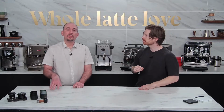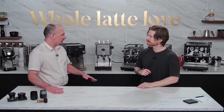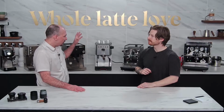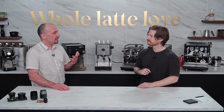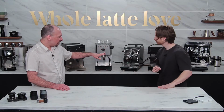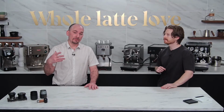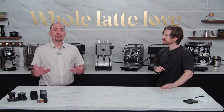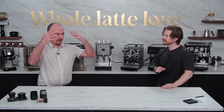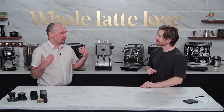Yeah. And so with the Latte, it is sort of addressing the potential issue that you may run into with any machine that is using some kind of pre-infusion that's taking water from the boiler without necessarily using a pump pressure, which is that in some cases, as we'll see on some E61 machines that we have here, you don't have much pressure left, so not a lot of water can actually flow. So it's actually pretty clever what they've done, where having the pump run first allows the machine to guarantee essentially that water is flowing, and then the solenoid valve just stays open.